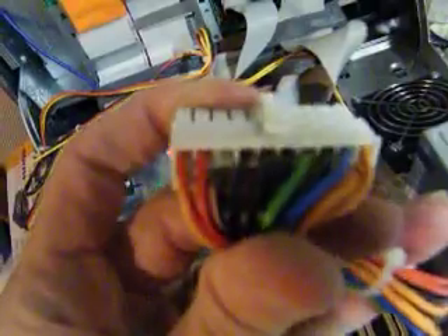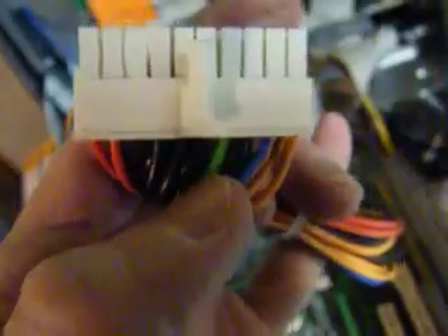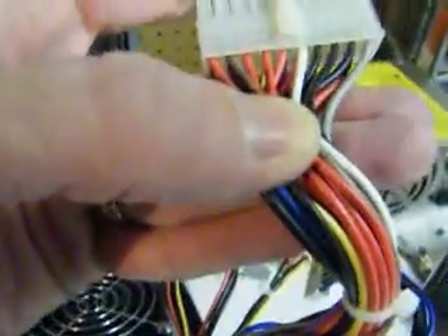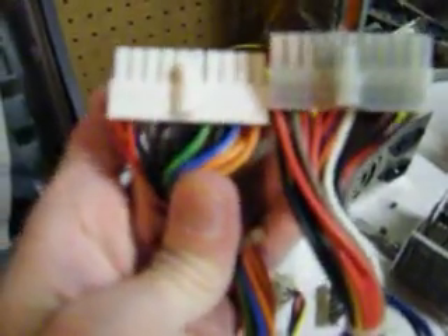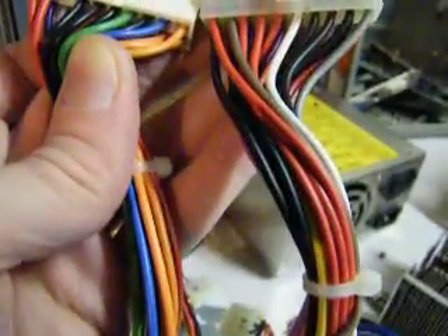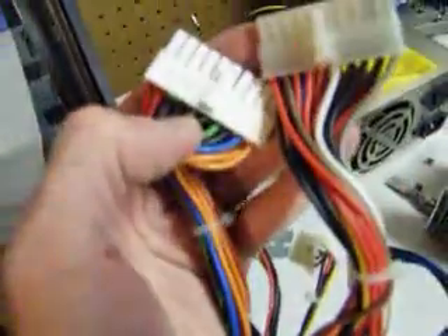Then I got looking at the wiring. Standard 20-pin ATX power connector, standard wiring: red, red, missing, black, black, black, green — that would be plus 5 volt times 2, a bunch of grounds, and a power-good or power-on line. This thing has the same 20-pin ATX power connector, but: orange, gray, red, red, red. Doesn't look at all the same. We've got red, red, nothing, black, black, black on one side; orange, gray, red, red, red on the other. So we're going to be connecting these reds onto this motherboard where the blacks should be — plus 5 volt directly to ground. That's not going to work too well.